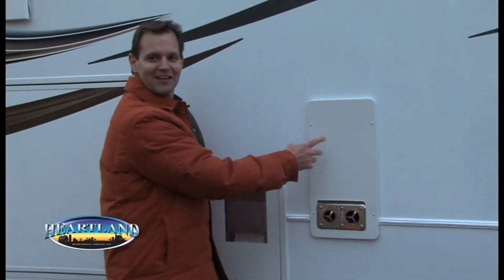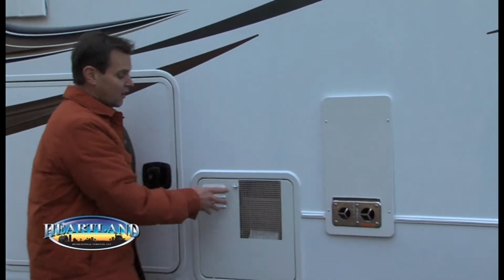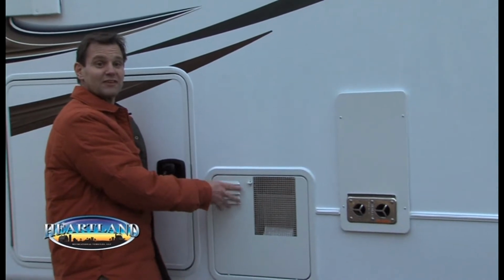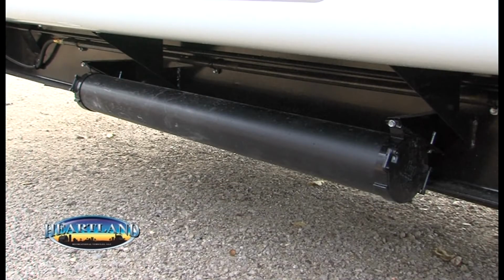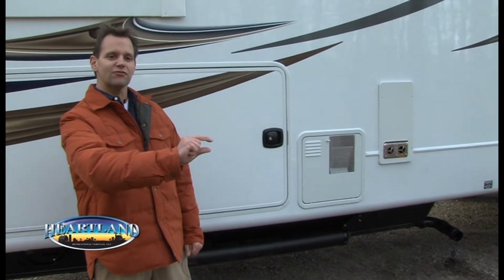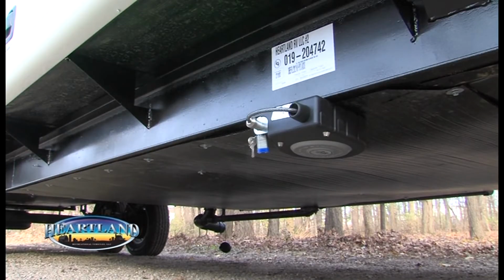The Bighorn 3685 comes with a 40,000 BTU forced air furnace. It also has a 12-gallon gas electric water heater, which gives you 16 gallons per hour recovery rate. All Bighorns come standard with sewer hose storage. All Bighorns come standard with a fully enclosed heated underbelly. We have a layer of astrofoil insulation underneath your tanks, and then we duct heat down into the system. This design protects your plumbing and wiring systems from the elements.